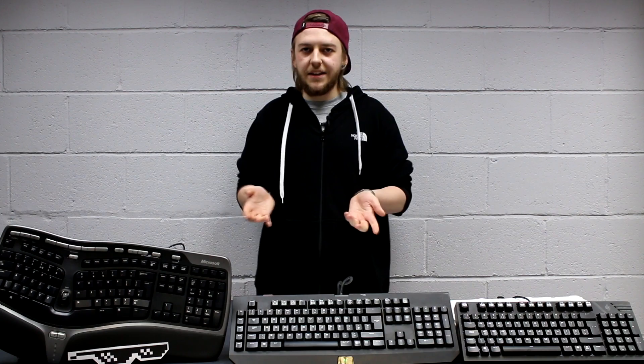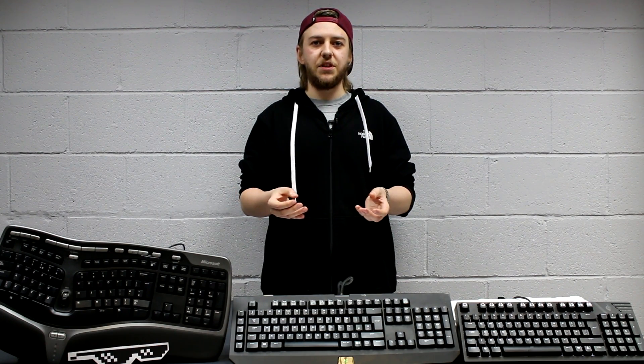For mechanical keyboards, because you have such a vast selection of different switches, it can be daunting picking out the one that's going to be best. My advice would always be: find a friend, go to a store, try out as many switches as you can to make an educated decision as to what is most comfortable for you to both game and type on. For gaming, the options you'll see most are generally black and red — the lack of tactility and smoother key press allows you to press keys quicker with more accuracy. For content creators, the Razer orange seems to be a good option — much quieter but still with that mechanical feel. If you like the idea of tactility or you type a lot, then the brown switch is the clear and easy choice. Personally, as I've gotten older and type more than I game, I use a brown switch.